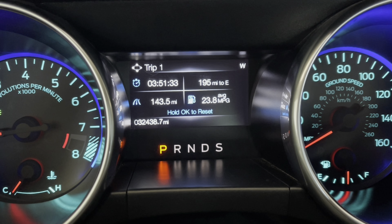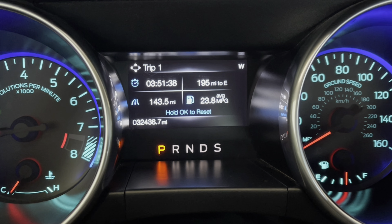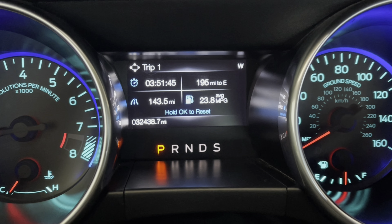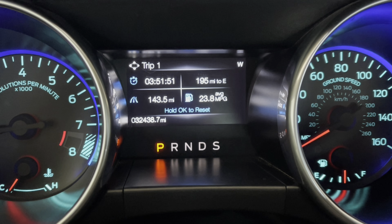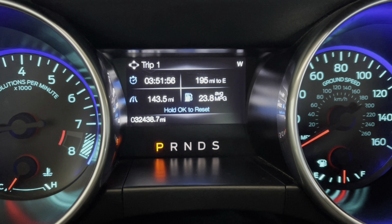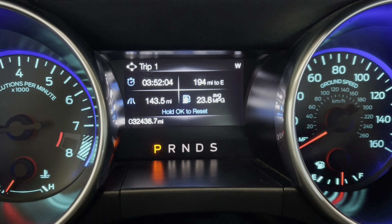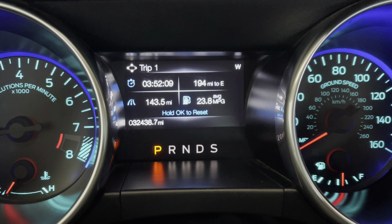I had to go hunt and figure it out because I didn't know what was popping up or what it meant. All it is is basically telling you to check your expiration date on your mobility kit. If you've never used it, make sure it's not over five years old. Only use it if you get a flat from a puncture in the tread — not on the sidewall — because it won't help with sidewall damage. It's basically like Fix-a-Flat; it'll get you to where you can go get the tire patched, plugged, or whatever you need. Hopefully this was a help — have a great day!